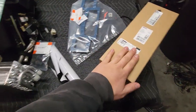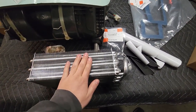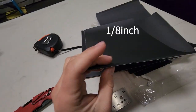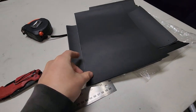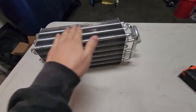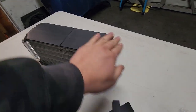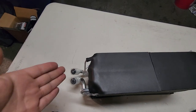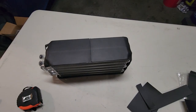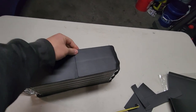This piece I'm going to reuse — it's super expensive, like two to three hundred bucks — and these are in good condition so I'll reuse them as well. Let's start with the evaporator and new radiator. There are a few pieces we'll need to cut to cover the top and sides before this is ready to go in. I'm going to put foam around the evaporator — this is the thickest foam I have. People use foam that's probably double the thickness, but I don't want to wait to order more. So we'll do top, side, bottom, and a little bit on the inside. I'll go ahead and measure everything out.